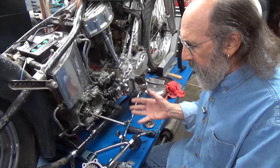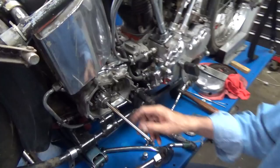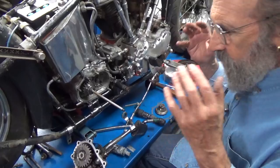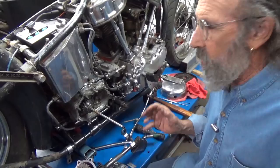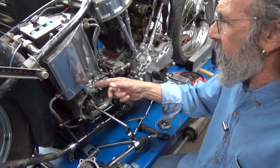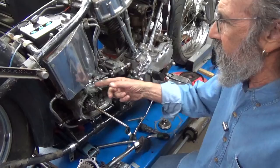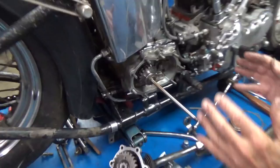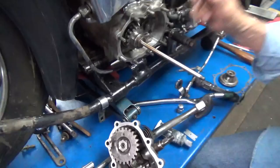I'm not rebuilding the kickstarter because it's fine — it's worn and old, and I can see where there's been different damage over the years, but that does not mean anything is bad. If we were to rebuild this transmission, strip it down to the case, restore the case, anything with any damage you'd replace. Now, the transmission is still loose in the frame from me installing the primary. When we get all done, we'll adjust the rear wheel, rear chain, and primary chain — that's accomplished by adjusting the transmission fore and aft. This is on the old bikes with open primaries and a chain.